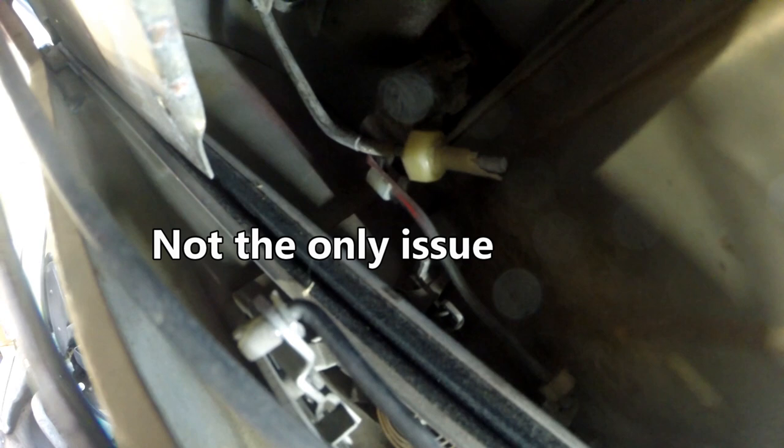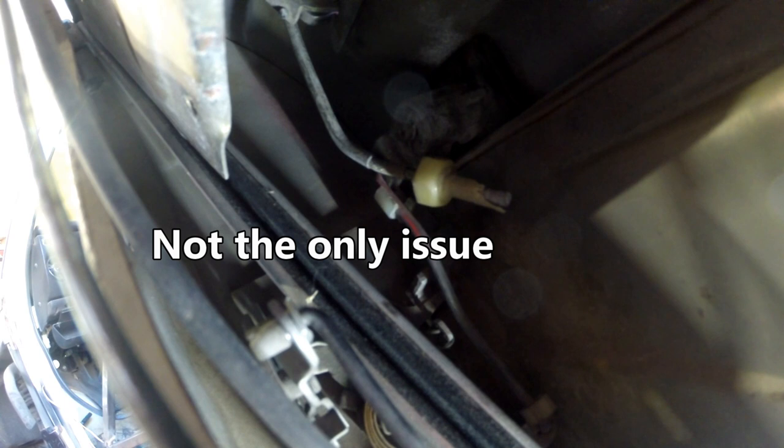Alright, so after consulting the factory service manual, this bar that is bowed is actually completely straight in the factory service manual. So I believe that's probably my issue, that over time and just hundreds upon hundreds of door openings, it's bowed itself and then slipped itself out of the hole like it's supposed to. So here I go, I'll go ahead and straighten it back up, and I will put it into the slot for the door opening and see whether that works.